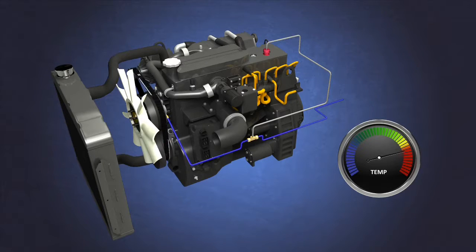In a spring-engaged fan clutch, there is an internal spring that is always trying to engage the friction material. However, the internal spring is overcome by the air pressure supplied to the fan clutch — a spring is trying to engage the fan clutch, but air holds the spring back while in the disengaged state. When the thermoswitch senses engine coolant is above specified levels, it sends current to the solenoid valve to shut off the air supply. With no air pressure to hold it back, the spring engages the friction material to the pulley and the fan clutch is engaged. When the thermoswitch senses coolant has returned to specified levels, it removes current from the solenoid valve to supply air, which compresses the spring and disengages the fan clutch. This is spring engaged and air disengaged.